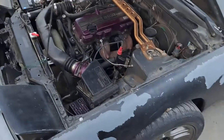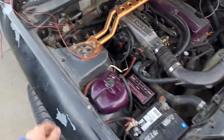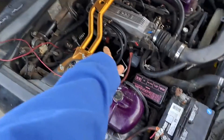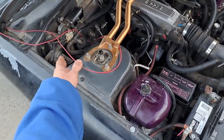We're having some problems with the 240SX. We were trying to figure out what's going on with it not cranking up, and we figured out that the wire going to the starter positive was going to the wrong thing.